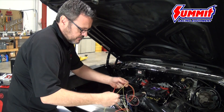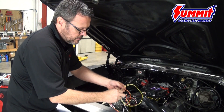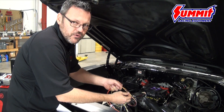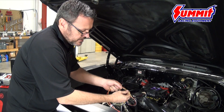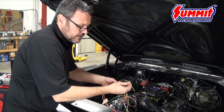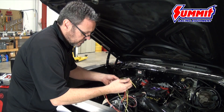The yellow wire is the fan control wire. It will turn a single fan on and control it at whatever programmed temperature you want, turning the fan on and off at that temperature — and you can set that with your keypad inside the car. This wire grounds the fan, so you do need a relay; it triggers the ground on a relay to turn your fan on.